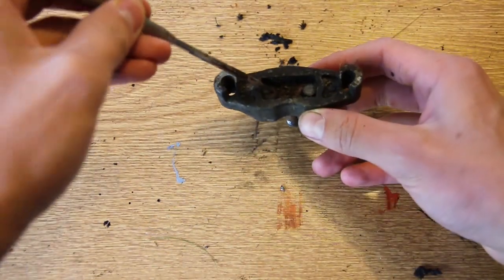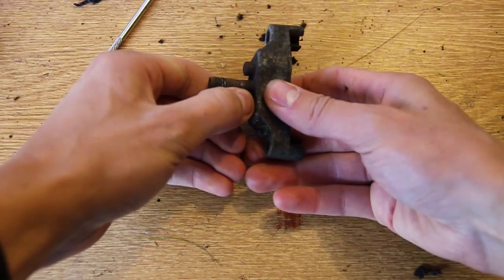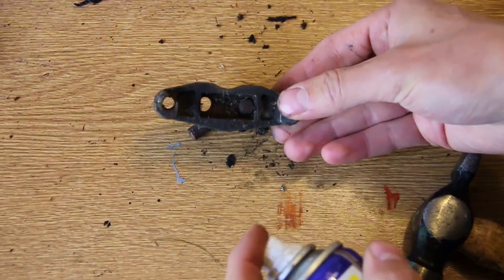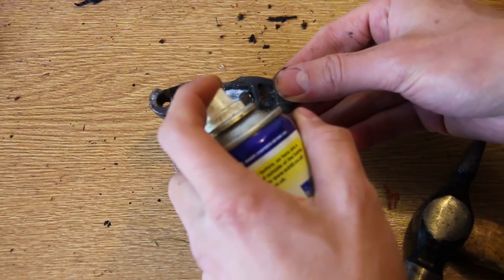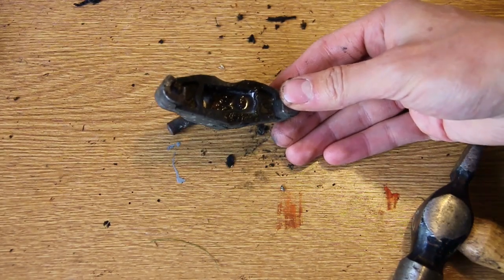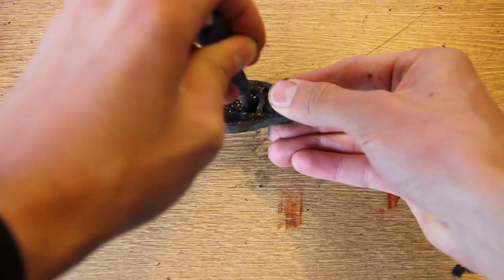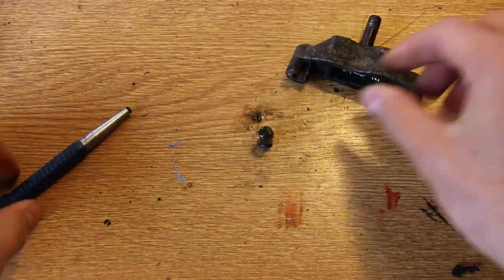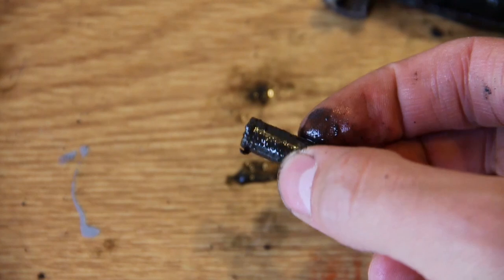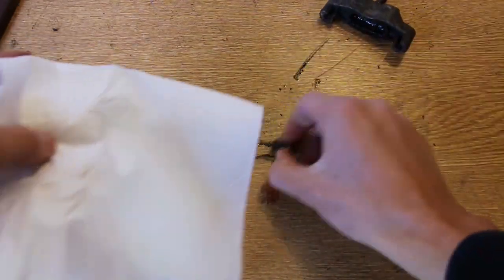This is the caliper with the two studs in. I'm just going to clear this out because I need to get that stuck stud removed. The first stud was a bit stiff but it still came out okay. The other one is completely stuck, so I'm going to put some penetrating oil in there and let that soak in for a few minutes — this should free the stud and then I should be able to push it through with a punch. You can see the amount of dirt and grime on there — that should actually be spotless. You need to clean that up and make sure it's shiny again.